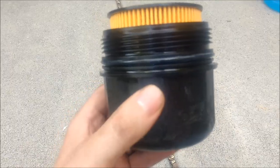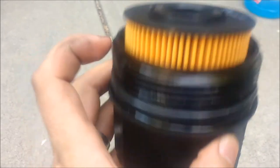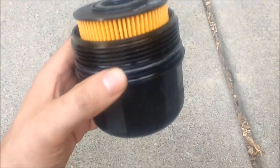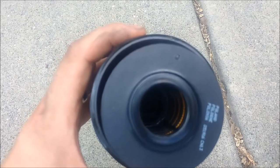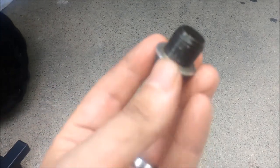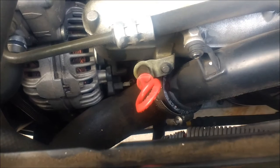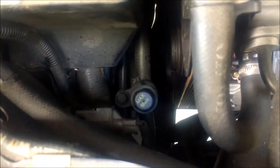We replaced the o-ring with a new one that came with the filter. We got a new Wix filter — it's symmetrical, you just drop it in. We're going to lubricate a little oil around the outside and on the inside. Putting the drain plug back in — you can see it has this little aluminum crush washer on it. We're reusing it because O'Reilly's didn't have one in stock, but you should replace it every once in a while. Oil change is completed. We also added some refrigerant — the low-pressure refrigerant port is right there. We got the plate back on so you can't see anything.